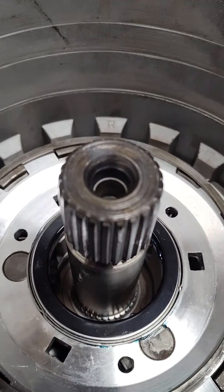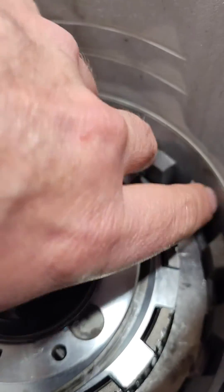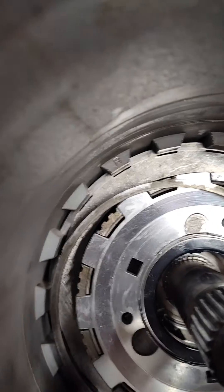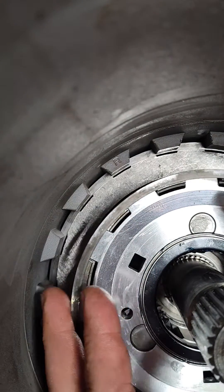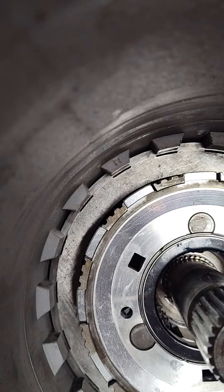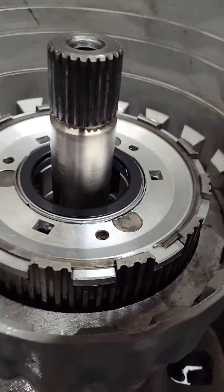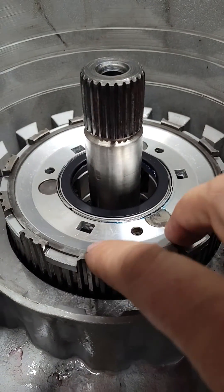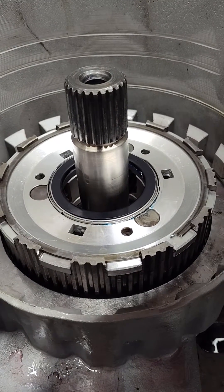Here's the snap ring people say they can't get in — they say the planet is too tall or the number nine kit is too tall. All you have to do — and a lot of first-timers don't know this — is grab this drum assembly and lift it up. I'll pull that up and now you just put your snap ring in, piece of cake. Then just push it back down. That just floats in there. So just remember: lift up on this assembly to get this snap ring in.